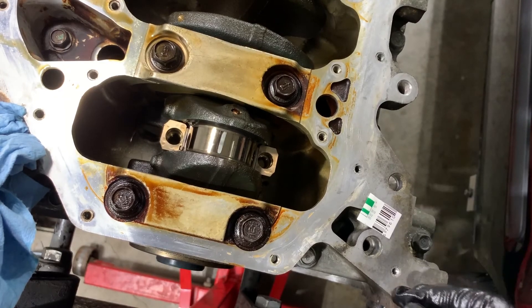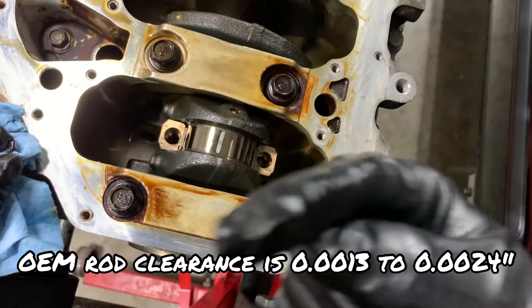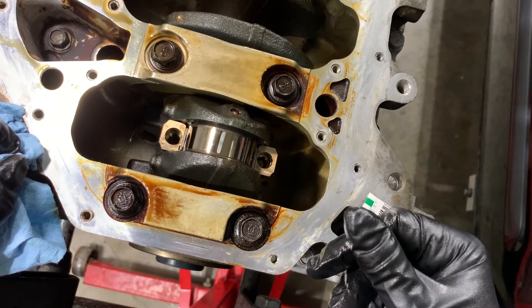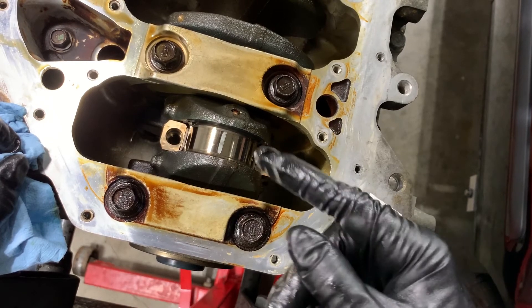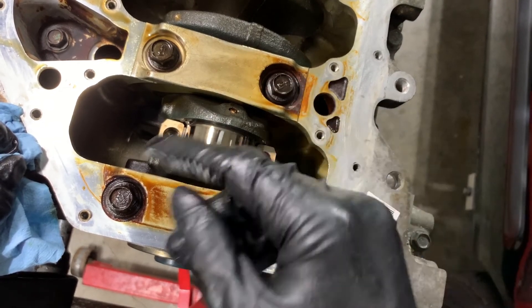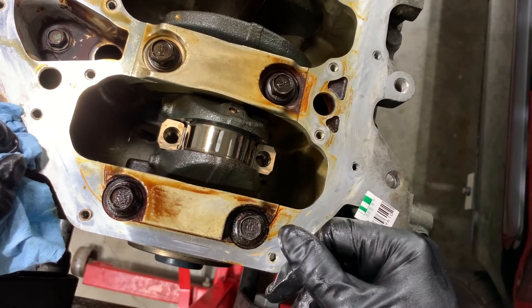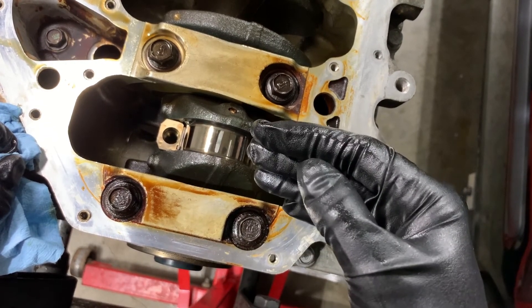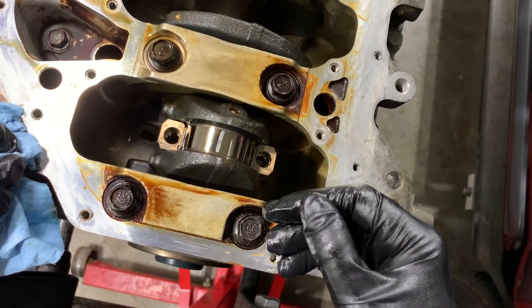Right at 0.002 — that's perfect. I believe that's actually the spec on these ones, so I'll look it up and put it in the description. That means we're good — the bearings are okay. They look fine, so I definitely don't have any reservations about running them again. These clearances are good, so we can go ahead, throw some assembly lube on here, drop the cap on, put the new bolts in, torque it down, and we know our bottom end is good to go. With this one being good, the assumption is the rest will be good as well. So we know we have a good bottom end in the K24 — the bearing tolerances are fine and I'm totally okay running it with the bearings it's got.